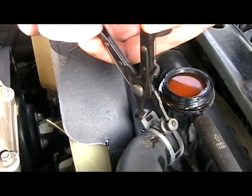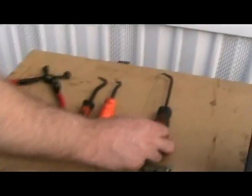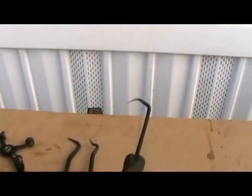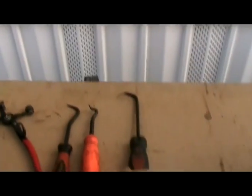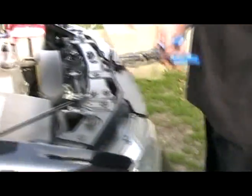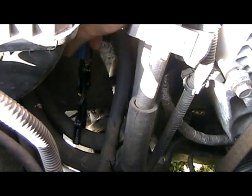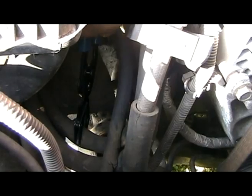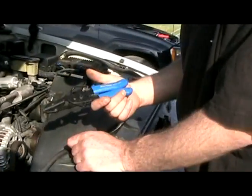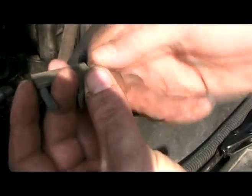That's how you can squeeze it and get it off without using regular pliers that want to slip off. Got a couple of different styles of picks for getting stubborn hoses off — you can get up in there from behind and just work it around to get that thing off. Also got some pinch-off tools for pinching off various hoses. I got these Blue-Points because they're probably the best ones I've ever used. There's also a cheaper alternative where you just slide your hose up in there, twist it down, and it'll pinch it off.